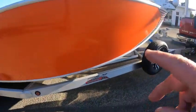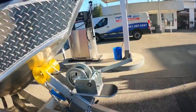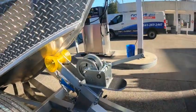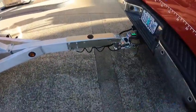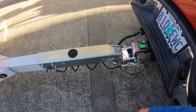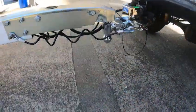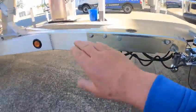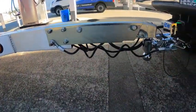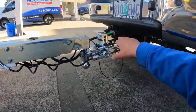It's a ProAx — you've got a step, so you come in here and step down. Don't let me forget about that carburetor. You can get down here — serial number, which they always should have — they've stamped it into the trailer. Brake fluid is under there; I already checked it. This has to be pulled all the way to get that cap off. You've got the flat flip with a safety pin in it — you can always get a lock for those. Cables versus chains — they don't rust. Two-inch ball, so if you've got a straight-out coupler like this, typically it's about 18 to 20 inches to the top of the ball.